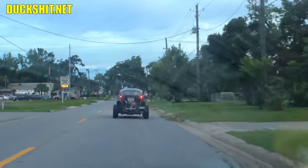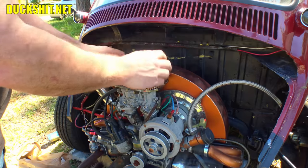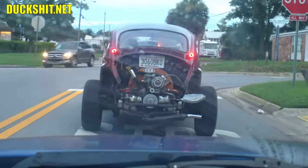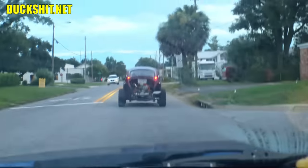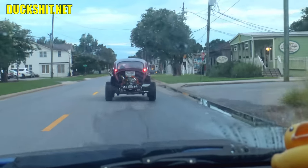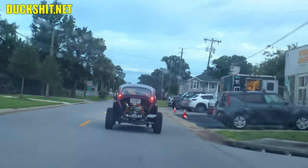Remember that old carburetor that faced straight upwards with a foam filter? Prior to changing it out, it rained a ton onto that foam filter, which rained water down the intake manifold — so there's probably water in that oil too. That water is boiling off because once it hits boiling temperature in that hot oil, that's exactly what it does. The breather on the right-hand side is not connected to the air cleaner and it probably should be to reduce crankcase pressure, but I don't like the way the vehicle runs when that's the case.